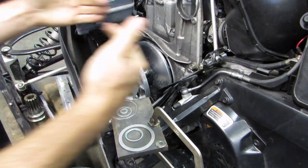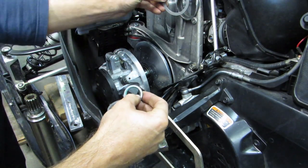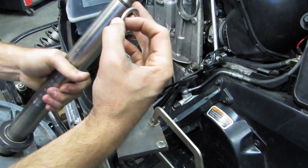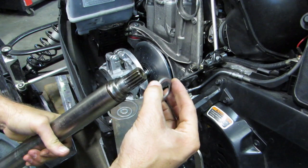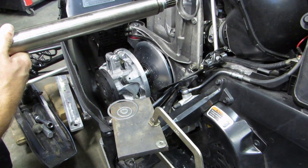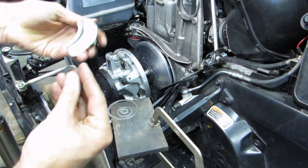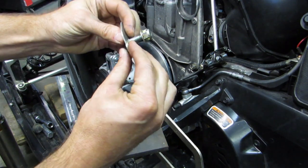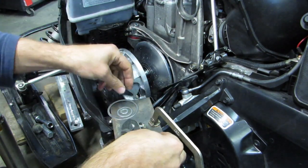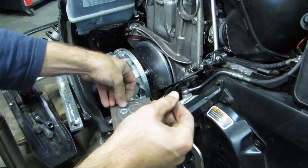Depending on what you need to shim your driven out, we have two kits. C&T Power Sports makes this kit — it's three millimeters. This big one goes in here to space the bearing out, and this smaller one goes on the end of the shaft to space that out. All you do is slide it over, then put it back in and reverse the steps you've already done. In the kit there's two more washers that go on the bearing retainer so when you put that back on and tighten it up it doesn't bend the retainer over because your bearing is further out. If you don't need three millimeters, we have another kit — this one's 1.5 millimeter so you can fine tune your offset.